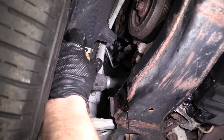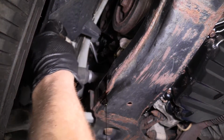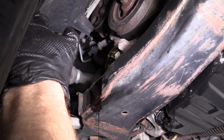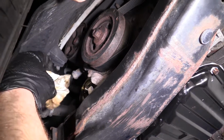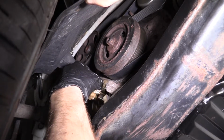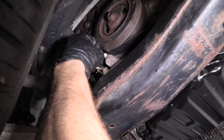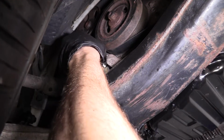We can let that finish draining a little bit, let it run off. Makes a nice mess all over everything. Also helps prevent rust. So let's say that it's pretty much all done draining now. We're gonna take our rag, we're just gonna go along it, just to make sure that the old gasket isn't still on there. If your old gasket's still on there and you put on a filter with another gasket, it's gonna be double gasketed, right? And it's not gonna hold pressure.